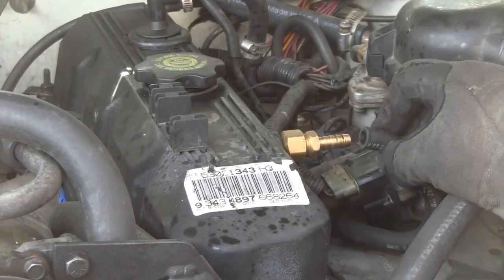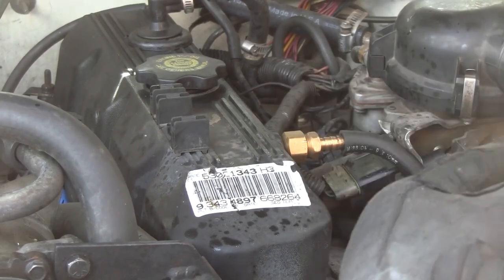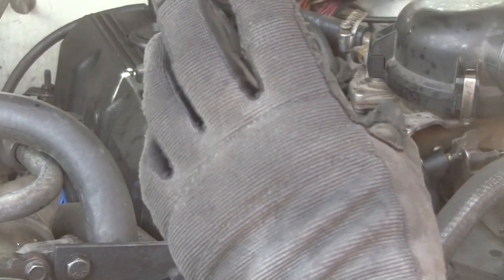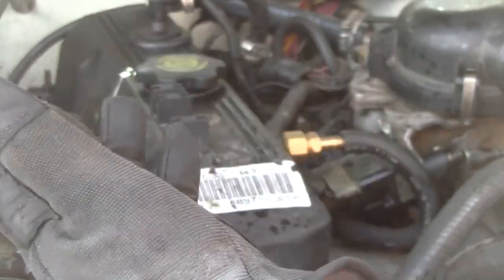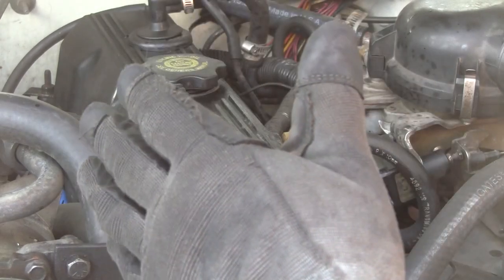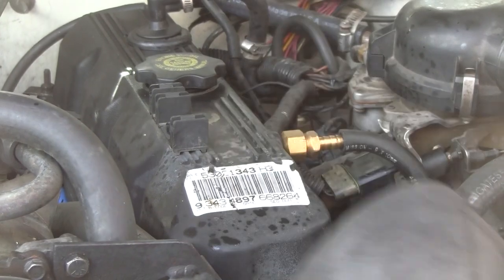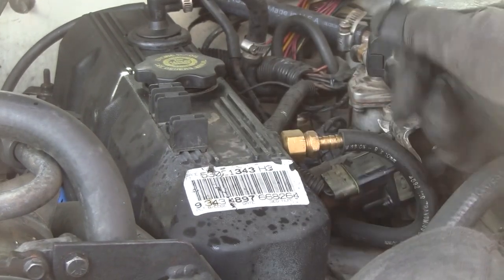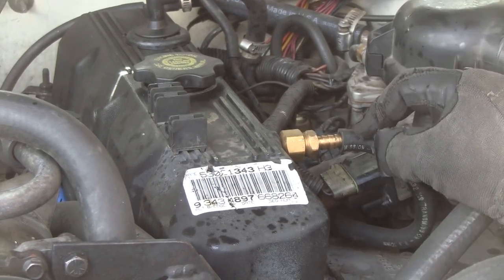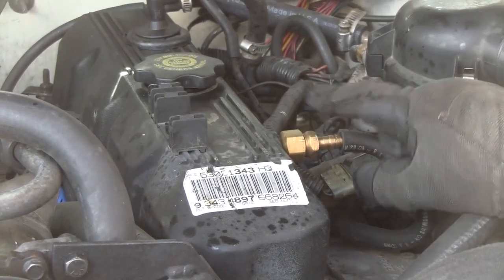What clued me into this was when I had the MT2500 scanner on here, it showed that the engine was running extremely rich at the low end and extremely lean at the high end. Now the extreme lean part, I'm not sure about, but I know sure as hell about the low end. It showed that it was adding a lot of fuel to the mixture to try and make up for a massive vacuum leak. Yeah, sure, there could be a bad intake gasket or something like that, but in the vacuum world, we call this a gross leak. It's severe. This has to be fixed. So what I'm gonna do,